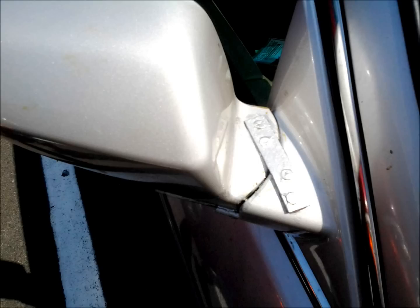If you use all four screws and put some epoxy under the mending plate as well, it'll certainly hold tight for the life of the car — unless you hit the mailbox again, of course. Also, what I did here is take some touch-up paint and cover the mending plate with it, so it looked a little better. But as I say, it still wouldn't suffice for a new car or a car that you want to look good.